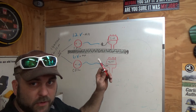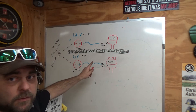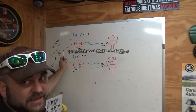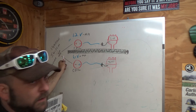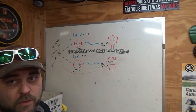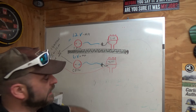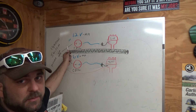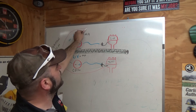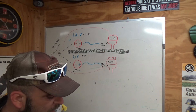I'm going to use this red marker right here. Originally in 6 volt, it comes direct from the switch — which is negative power — and the negative power goes right to the top of that coil on the distributor. If you're converting it to 12 volt, you've got to remember that all your polarity is going to be changed, so it's going to go from the positive to the distributor. It's pretty self-explanatory when you get in there.